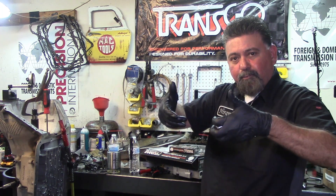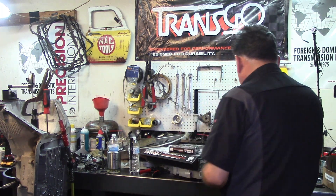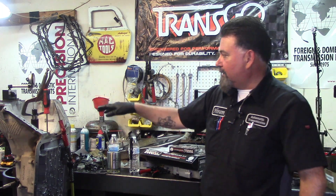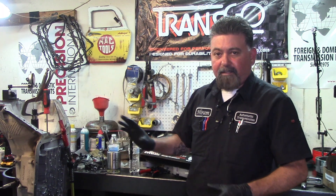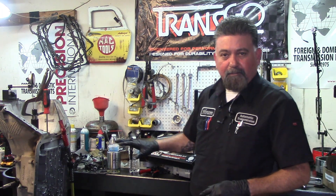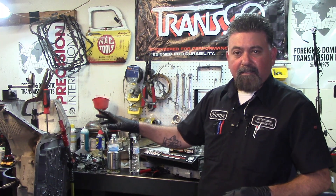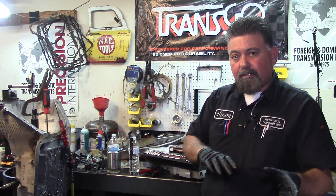Hold the center support and pick up the front planet - you want just a little bit of play, not real tight. I'm going to lean the transmission to the side, check the front section, and look inside the barrel of the case. The rear is already set up. I'll just film the clearances and then finish the unit. The build has an HD2 kit. Let me get set up and look at the front section.